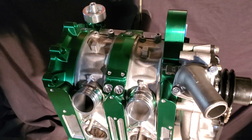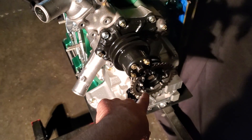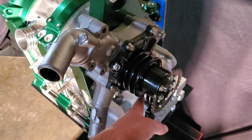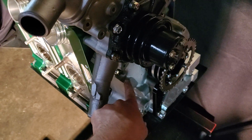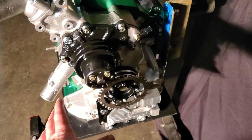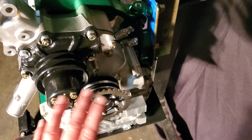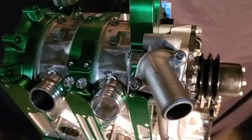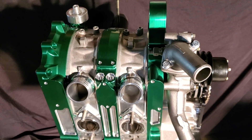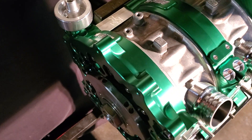I just want to thank all the people who did this — Mazda Tricks, Billet Inc, Chip Ursu. We've got a full function engineering reluctor and wheel setup on here and a modified Racing Beat front pulley. And then this right here is now very rare — the Mazda factory dry sump setup. This did come apart. We ended up WPC treating specific components. I did a little porting and polishing to ensure the best flow possible. I run those same front covers on all of my race motors. Although they're hard to come by these days, they perform fantastic. Internally, Mazda Tricks handled all of our lightening.